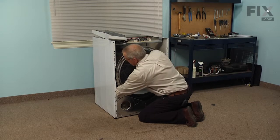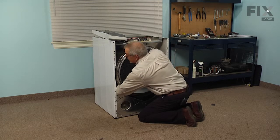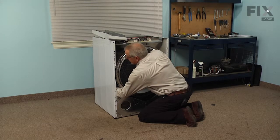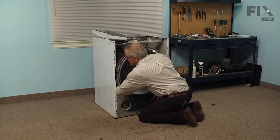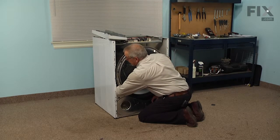Now if you find that difficult, you can roll it onto the motor pulley first and then pull it up around and over top of the idler pulley, but you will again need to put tension on that idler pulley, pushing it towards the center of the dryer, making sure that the belt that runs down on the left-hand side is already to the left of the idler. It's the portion of the belt that comes underneath the drum that we need to roll around the front of the idler and up into place.